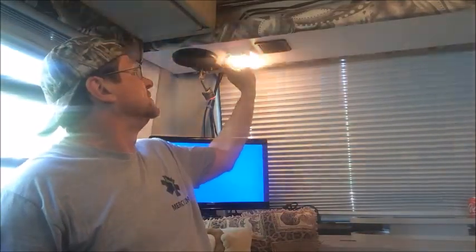When a battery is in use for, well, lights and the other conveniences that make our Rialta so much fun to have, that's a normal way for the batteries to discharge, and when we drive, we recharge those batteries. But if the batteries are left in the Rialta for a prolonged period of time, even when they're not under use, they're still discharging. That type of discharge actually weakens the battery if it's allowed to occur over and over again. And each time you go to recharge that battery, you're going to have an issue because it's not going to reach its former full capacity.